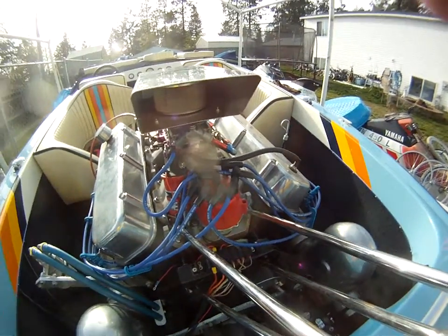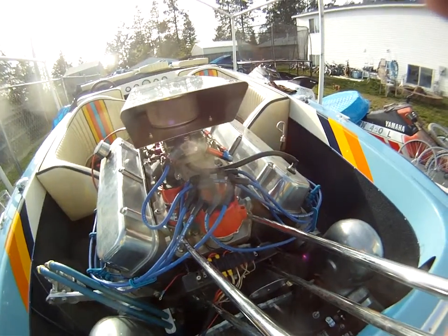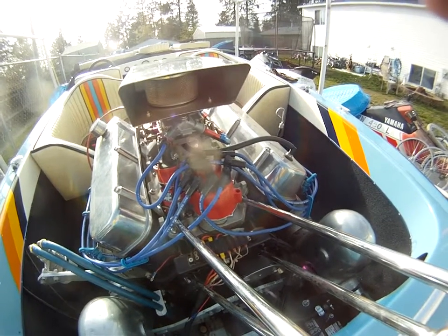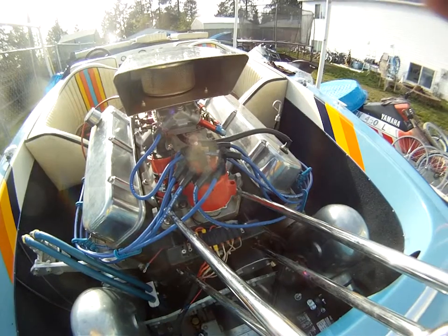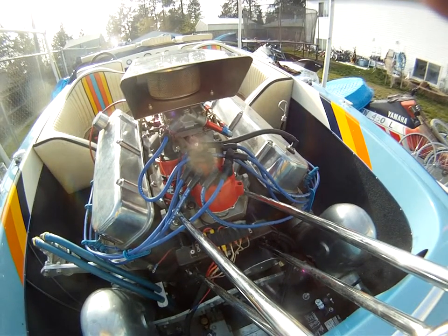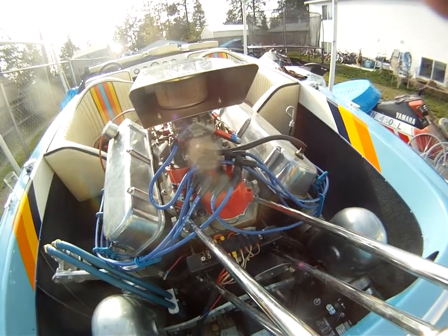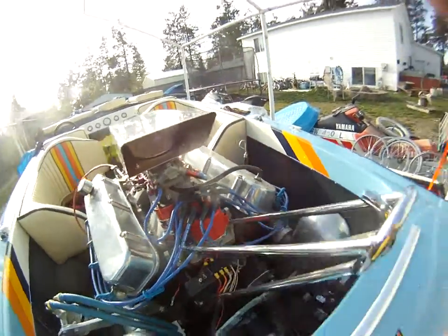One of the reasons why I got so involved in working on this was when I would turn the engine over initially after putting this new distributor in. I was getting kickback and actually broke the starter right off the case of the engine — the starter itself broke. I went through three different starters and kept getting kickback and couldn't figure out why. Some people were suggesting checking the phase on the distributor. What I ended up finding — what I believe was the actual cause — was the air gap on the pickup. GM, like I mentioned in the earlier video, MSD was saying it should be around 30. I've read articles saying MSD sets it at 30 to 35, and other places say 15 — it's just all over the place. I believe that 18 seemed to work for me and I'm not getting kickback anymore and this thing fires right up, so I'm pretty happy about it.